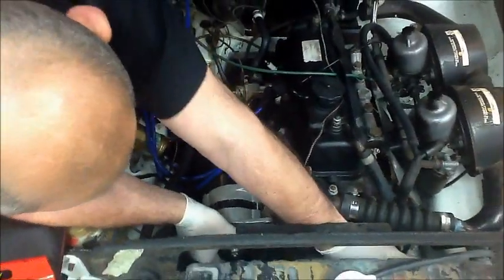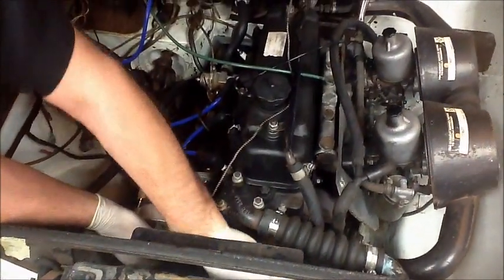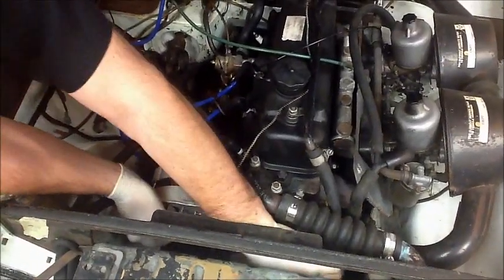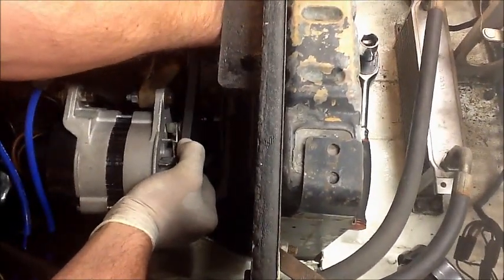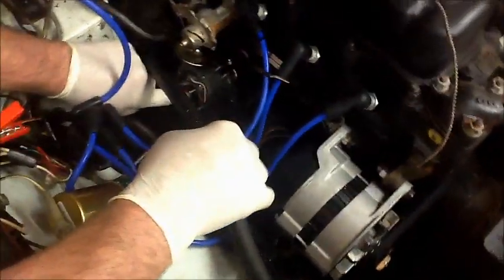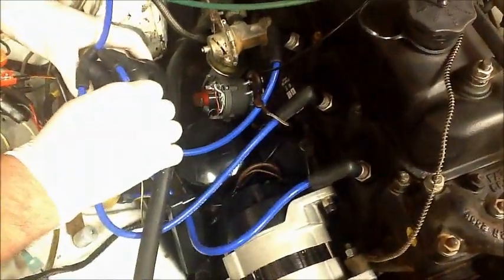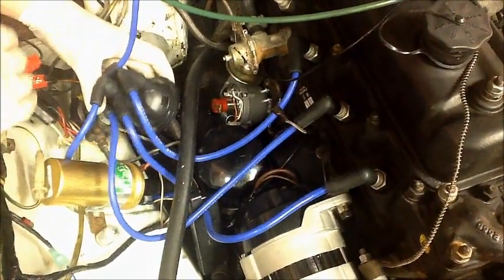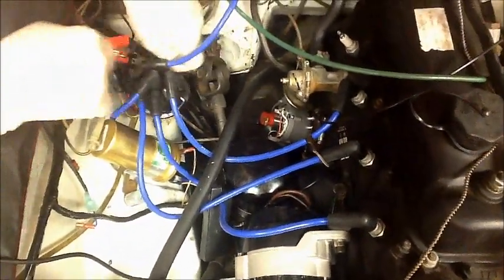It's going to take a couple of seconds just to pull it round. The marks are just coming round — pulling the mark round with my hand. That's now top dead centre, and the rotor arm is pointing in the two o'clock position, which is number one cylinder. So when we go back it'll all be exactly as we took it out. This car has an offset key where it can only go back in the way it came out, but some cars with a gear can go back slightly differently, so doing this is just a double check.